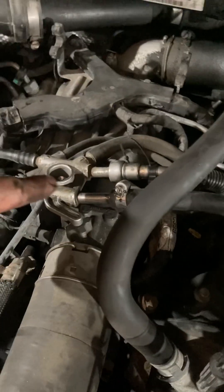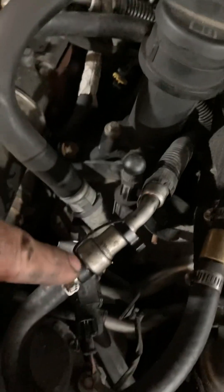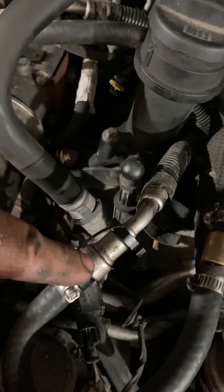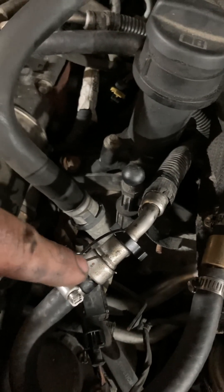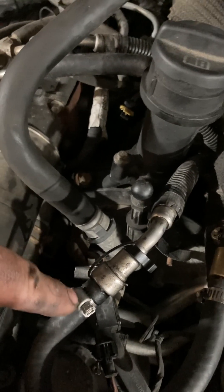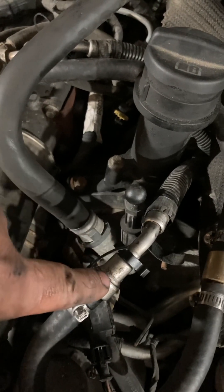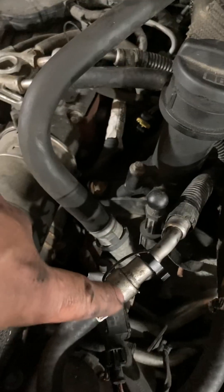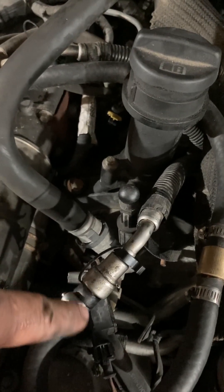This is the line I actually took off the fuel manifold. I have a small piece of steel line — Dorman part number 800-159 — which is almost always in stock at your local AutoZone or can be ordered from a lot of different places. It's a 3/8" line with a special flare on it that clicks into this line right here. Also, you're going to need a fuel line disconnect tool, which I believe comes with the fuel pressure testing kits on Amazon and eBay.